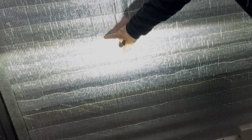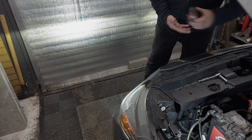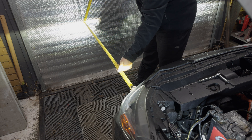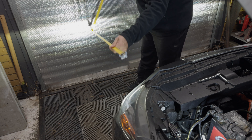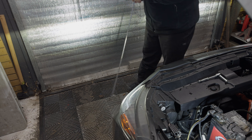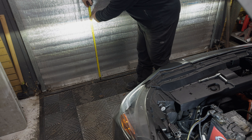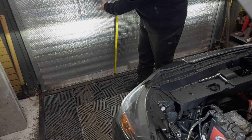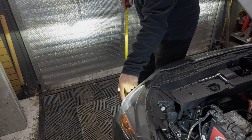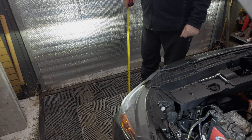This line I drew on the other 2018 Leaf is pretty much 30 inches off the ground. You can see the car's headlight itself is about 50 inches away — more accurate if you're farther away, but I have a pretty small shop. I took this reference from a Leaf that was not causing any complaints and where I think the lighting is really good. The bottom of the line is about 30 inches up, and if you measure at the light, the top of the low beam is almost precisely 30 inches — pretty much level lighting.